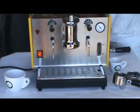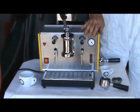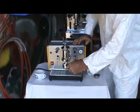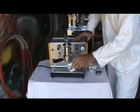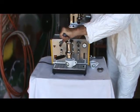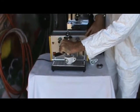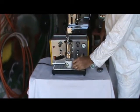The thermosyphon feature on any group basically means that when using the machine, you have to make sure that you deliver the adequate amount of heat to the group. You do this by flushing. Whether it's a big commercial machine or a smaller machine like this, you can see it's just not hot enough right now — you can tell by touch. So the first thing you do to prepare a shot is preheat the group by flushing the water, and you can really feel the heat come up. Depending on your usage and how long the machine's been on, you might have to flush a couple of times.